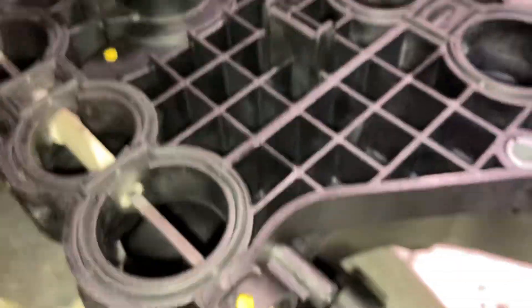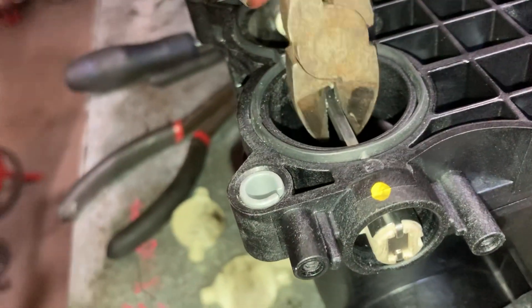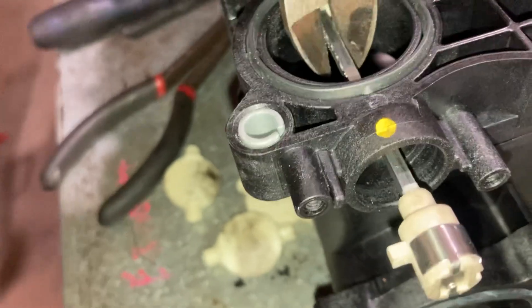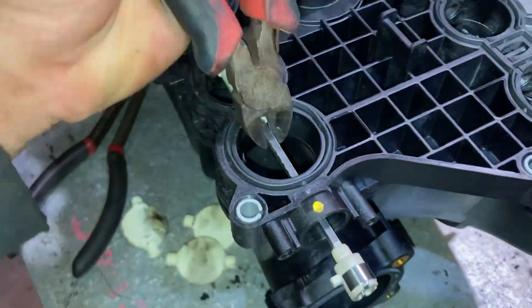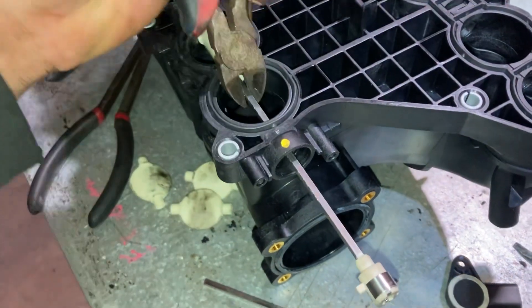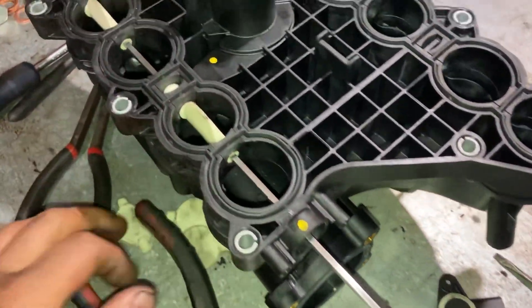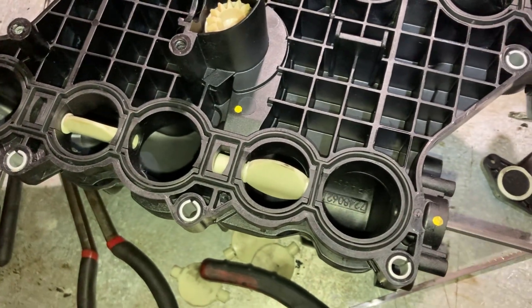You can see the magnet inside that the sensor reads. To remove the shaft, a pair of side cutters works really well — grab it and slowly do that rocking motion to pull it straight out. Keep working it until it's loose enough to pull out by hand, then it slides out like that.